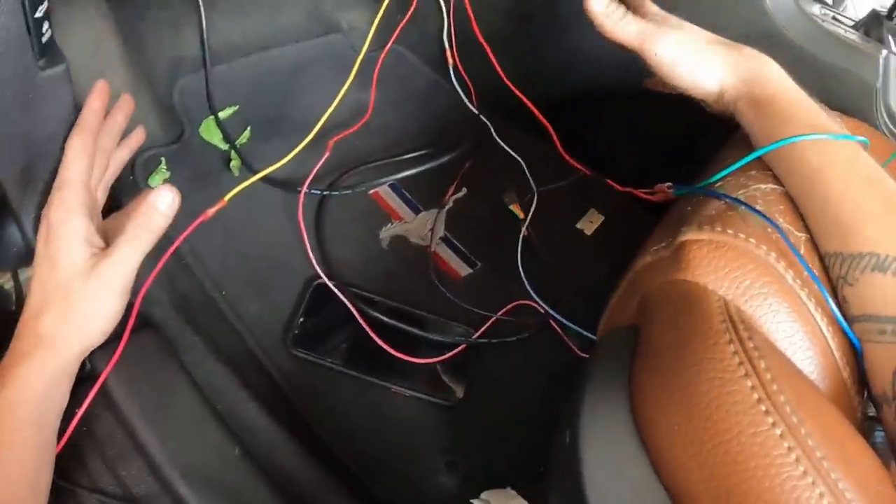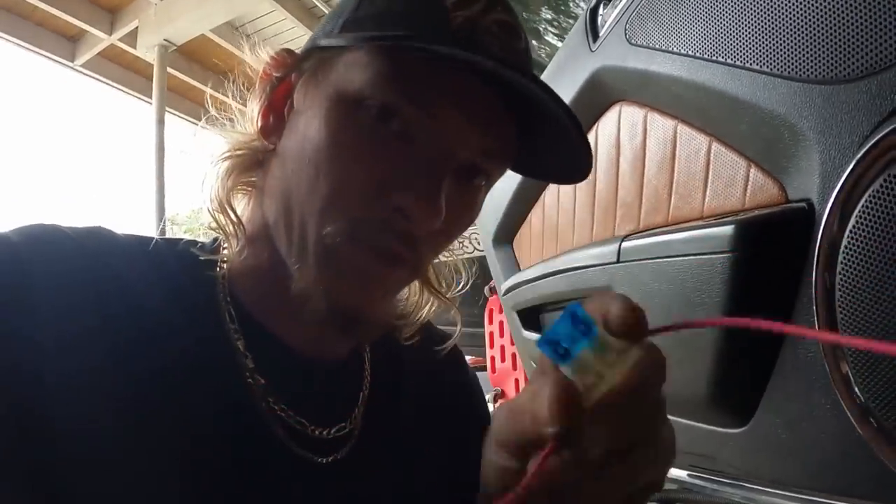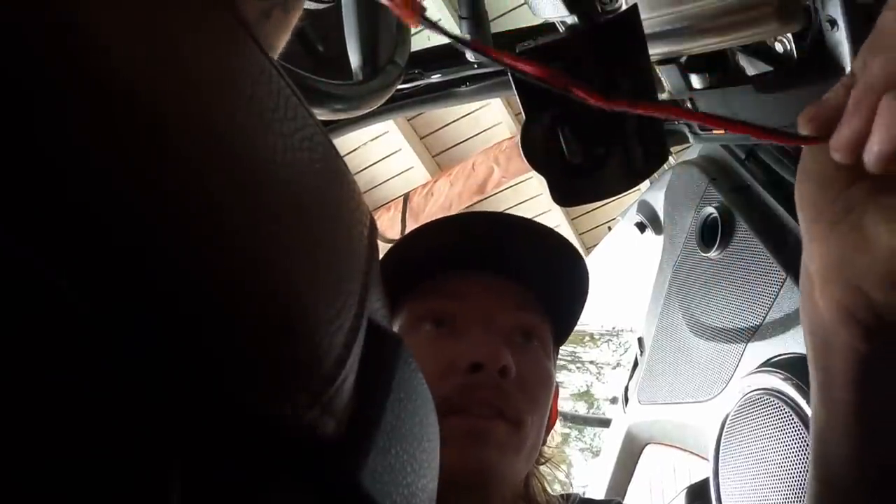This is gonna confuse you guys so I'm just gonna stop the video right here and figure this out. Those existing wires that were run back there — I'm only using those because I don't have to run any more wires. I decided to use this yellow wire which is hooked up to a constant fused power — that's going to go to the constant 12 volts of the gauge. Then this black and red wire with multiple butt connectors causing resistance — I'm going to use for ignition-on, tapped into a 10-amp fuse. I'm going to try and pull out all these unnecessary wires.